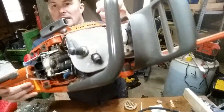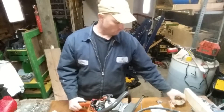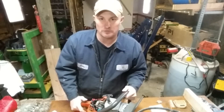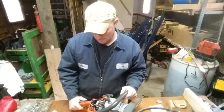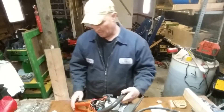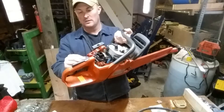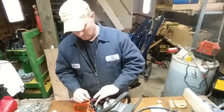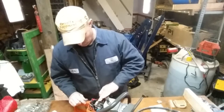When I pull this off, you can see it's kind of dirty there on the top. I got this tip from a guy I've been watching for a while — really good channel, Homestead Jay. So if Jay's seeing this, hey buddy, shout out. He just did a video about getting your saw ready for wintertime — check it out, it's Homestead Jay. He brought up a good point: if you're ever working on this, to keep the dirt out of the inside of the carburetor, just pull your choke out because your choke will close everything off. Good hint, Jay.